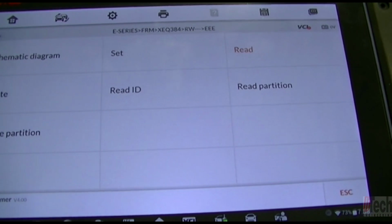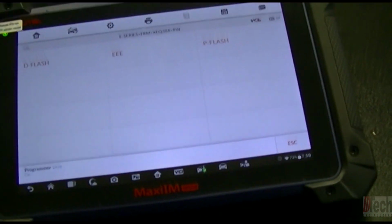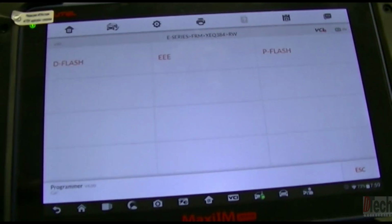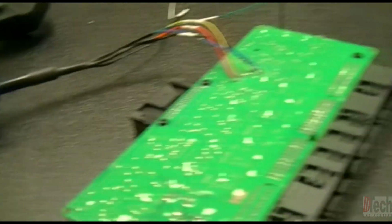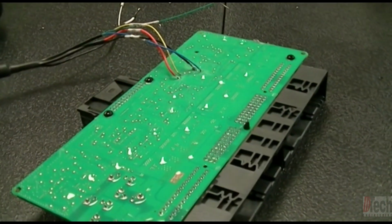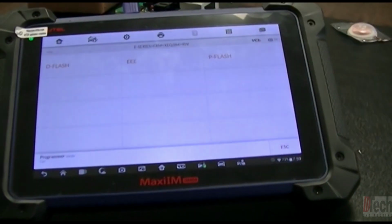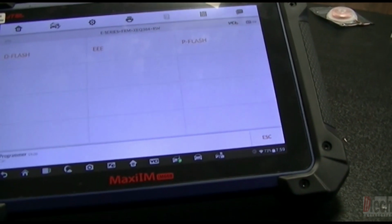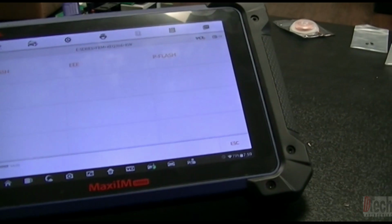Ready for information. Now there are a couple of ways that you can go about completing the job. This is the first section. You have to reset it, wipe it out, get rid of the corruption, and that's done by the write partition portion. At this point, you have to put information into the FRM in that EEPROM section for it to operate 100% correctly, as far as knowing the options, lighting equipment, and how many 4-door, 2-door for the windows, all that.